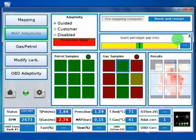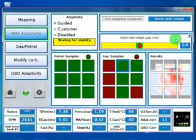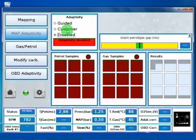You will see that sometimes the red circle disappears because we are running in a point where maybe we have no samples, or maybe we are taking it. While the red circle is in the green square, it means that we are in tolerance, so there is very little difference in injection time from petrol to gas. While when the red circle goes into the yellow bar, so it goes out of the green square, it means that we are a little bit far away, and the ECU will make some adjustment to the result map to make the time match. Okay, now we try the customer adaptivity.